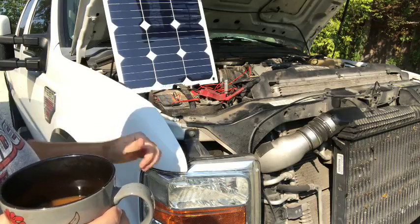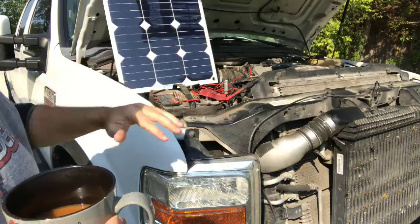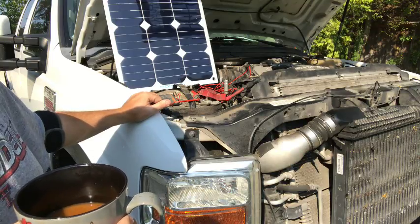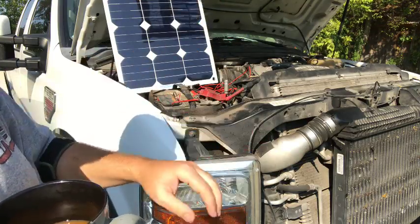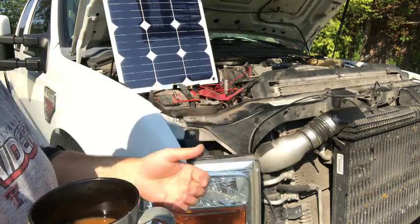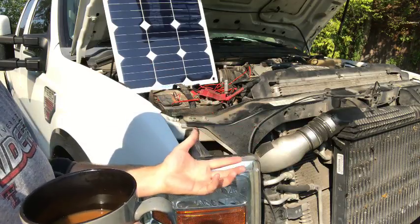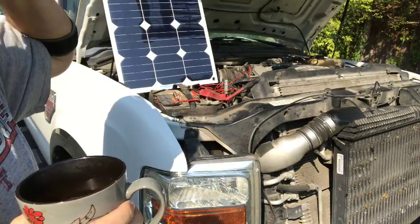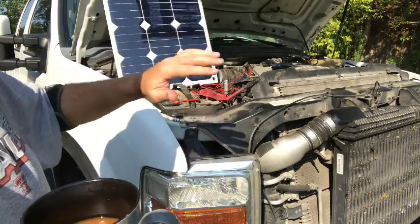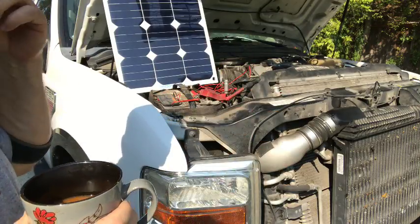The mistake I made is I sprayed the next day on it, and what happened was where I needed to mask off with tape, the good thing about the epoxy primer is it's sticky. Stuff sticks to it, right? When you spray more paint on top of it, it really bonds to it. Well, when you stick tape to it, it bonds to it as well. So I had a little bit of the glue come off, even though I was using 3M tape in some areas. I probably need to wait 2 days on that epoxy and let it cure a little bit more, and use a tape and not really press the tape in so much. But if I don't press the tape in, I can get blow throughs underneath. So it's kind of a double-edged sword.